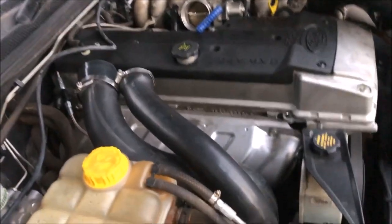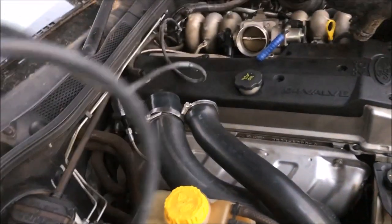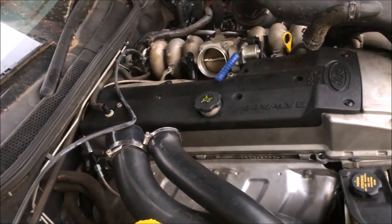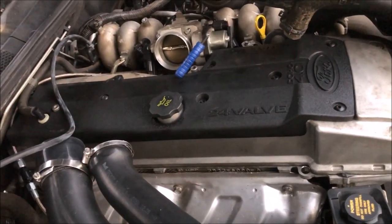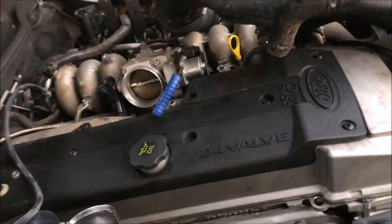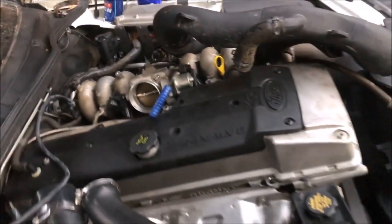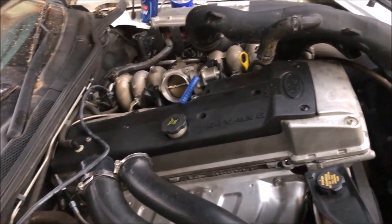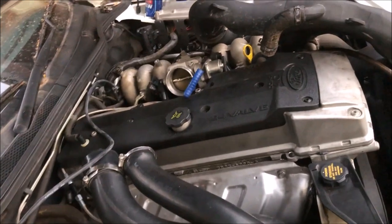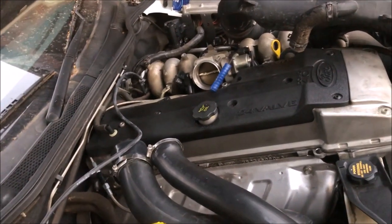Let me tell you where I'm at. I've got my coupler and my vacuum hose. I went to start it after I put the 2-bar map sensor in it yesterday — and it won't start. It just doesn't like it. I tried plugging in my original NA map sensor on the side and I actually got it to run, but it idles like it's got a massive cam — chugga-lugging black smoke. It'll rev but it just blows heaps of black smoke. This is stuff people won't tell you when you're doing one of these conversions — I want to make sure you guys know exactly what works and what doesn't.